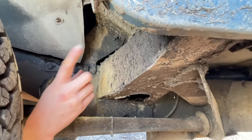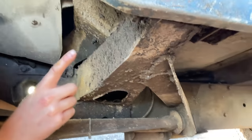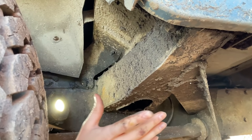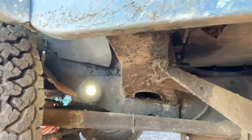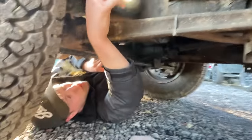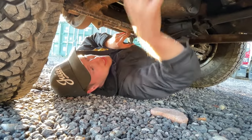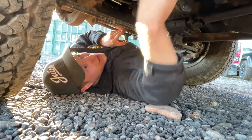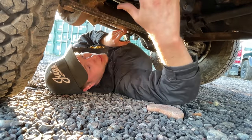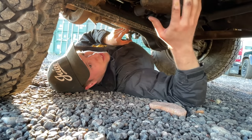In that same area, the bottom of the footwell meets the chassis outrigger. Mud tends to sit right on top there and will eat away at the chassis and the footwell until there's nothing left. This will be a sign that the vehicle hasn't been cleaned or maintained, so make sure the footwells are intact and not rotten. This actually looks like it's had some new welding, which means it has been maintained - and you can repair these things, but you want the best version of a Defender for your money.